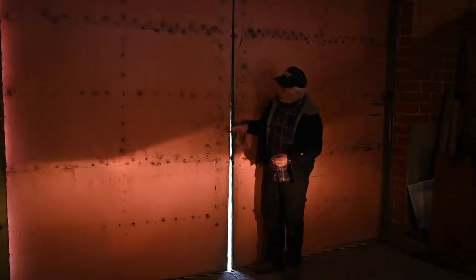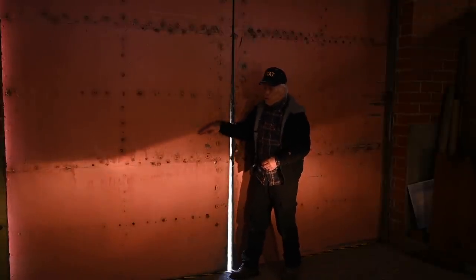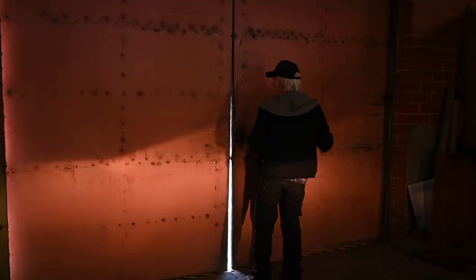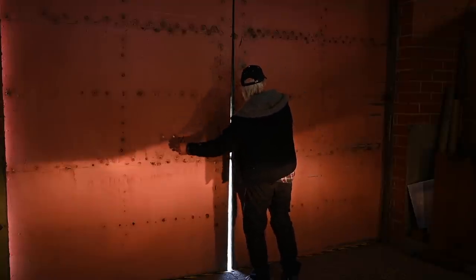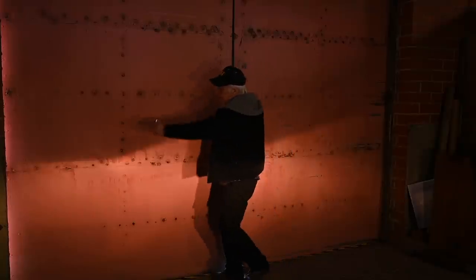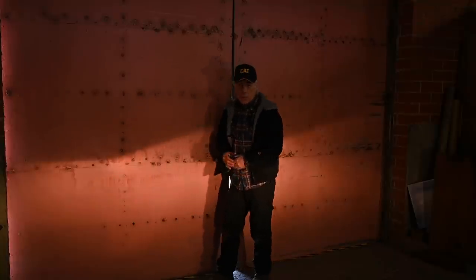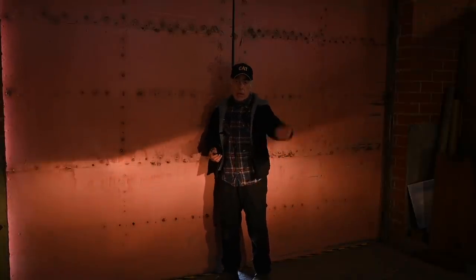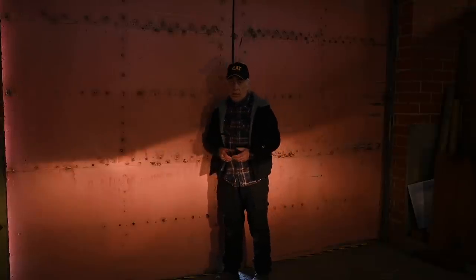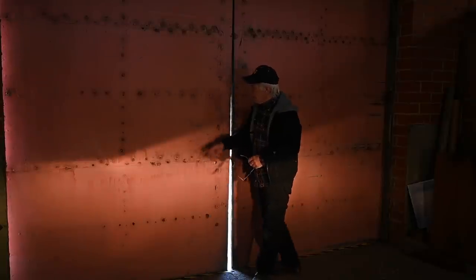Have a look at the pattern of the light — you have this slope here, and that's the result of the big slice I showed you on the light. It's pointing to the right because I have a left-hand drive car, so I need all the light on the right side of the road. On the left-hand side of the beam it goes down a bit — a downward slope — so as not to hinder cars coming towards me. If you live in Australia or the UK, it's just the opposite.